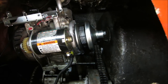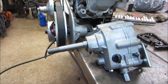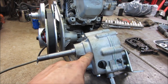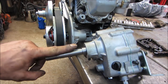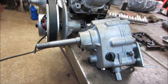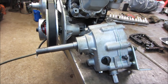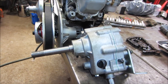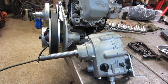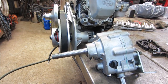I've got to take it back out and look at it. All right, so I've been staring at it for about 10 minutes. And I think we're going to reverse ourselves again and see if we can get this back tucked under here with this clutch on it, and then just having that gear go down to the jack shaft. It's just so many components, so many links to link all together. It's going to be prone to jumping chains, and trying to adjust one, you adjust one, you've got to adjust five other places behind it. So the more that we can minimize that, the better we are.